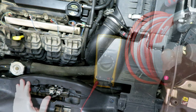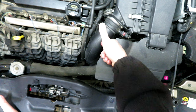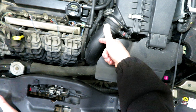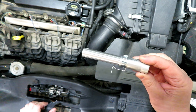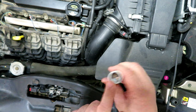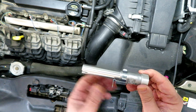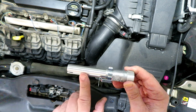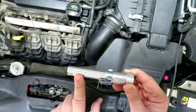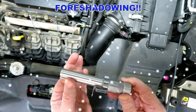So I think we're going to have to replace it. First I need to figure out where that block heater is, and through some research I found out it is in the back side of the motor. It's a cone shape where the cord plugs into the end, and it clips into the block of the motor. The beauty of these is there's a space already designed into the motor to fit the heater — no water jacket needs to be opened up, and you don't need to drain your coolant. It just slides into the block and a clip holds it in.